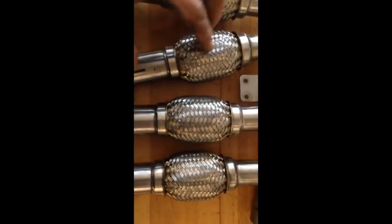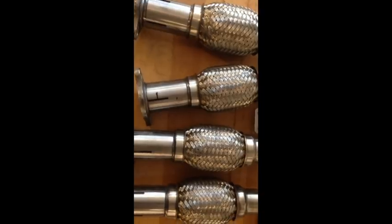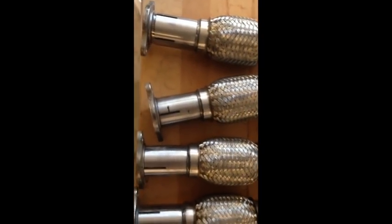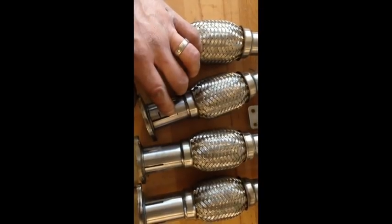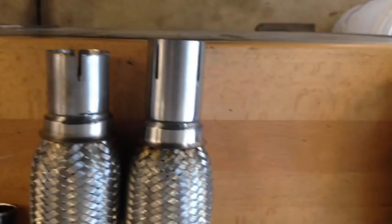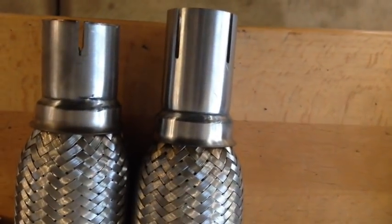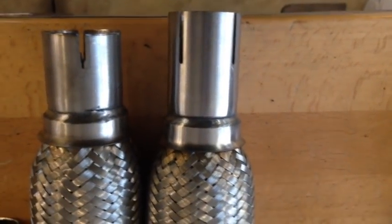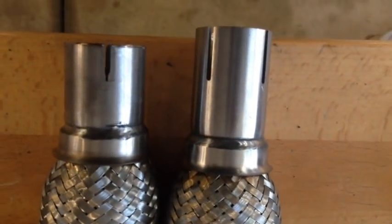Trim that back. By trimming that, it's going to move everything forward. Moving everything forward, get your bolt holes lined up, your rivet holes lined up, everything back in line. So that'll be our next step. And also you can trim these notches in a little bit more to fit the clamp width. So there's my 1/2 inch trimmed off. Now that should all line up in the machine and we'll put it all back together.